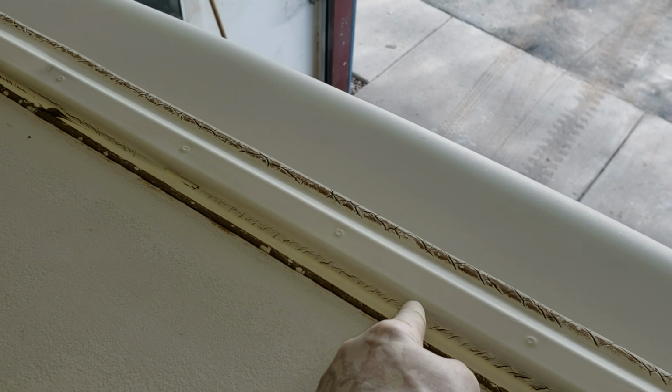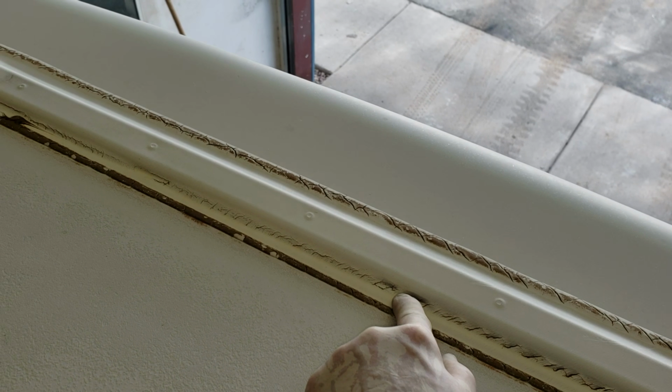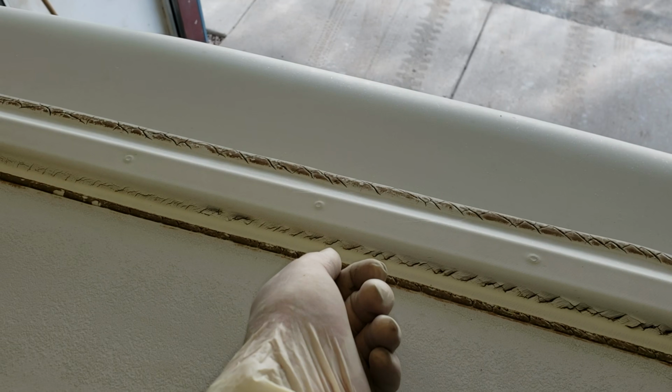I was just cleaning the roof on this, and so in order to actually do this, I just can't put a bead of sealant right there because that doesn't get rid of this gap underneath there. So what I have to do is cut out both sides of this so I can expose that gap. Otherwise, trying to clean all this off, that's got to be close to $700 in labor and put it all back together again. So this is why I'm not a huge fan of Eternabond. If it was just Dicor or roof sealant, I could scrape that off really easily and then seal it back down again. It's really not a big deal to scrape and seal.